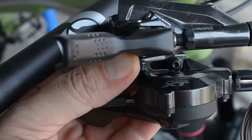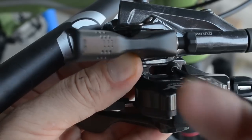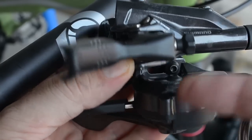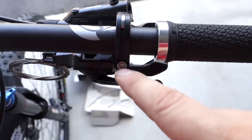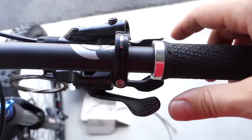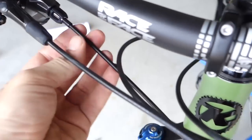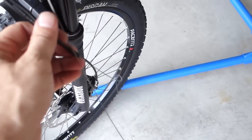What they've done this time — you can see with a 3mm Allen key you can loosen that up so you can move your shifter relative to the brake lever. This is maxed out in. The adjustment allows me to push my levers out that way. I cut the housing exactly the same length as I had it before because it worked perfectly.